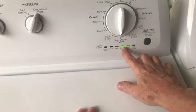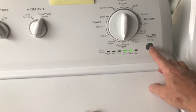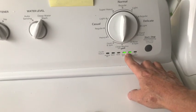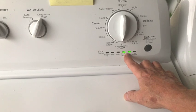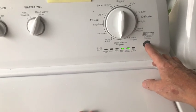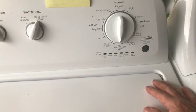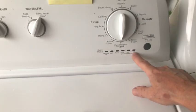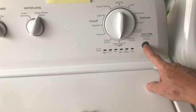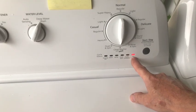Keep going clockwise until these two LEDs are lit. When they're lit, you can press. This will put it into service diagnostic mode, and you toggle that by pushing the start-stop button one time. Now to agitate or spin, the lid has to be locked. With all LED lights off, push the start-stop button one more time and the lid lock activates.